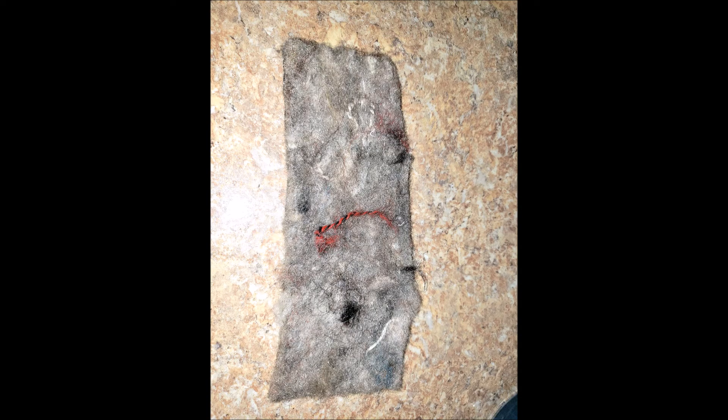Next was to put some hot glue on the small underlayment piece and push it completely through the tear and press it against the chassis metal until the hot glue cooled and held the underlayment in place. So that underlayment was fully behind the tear.